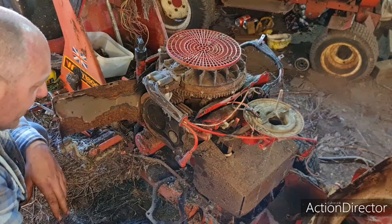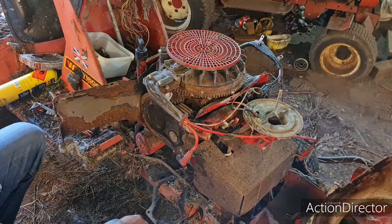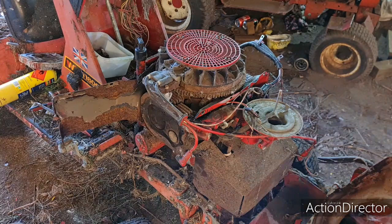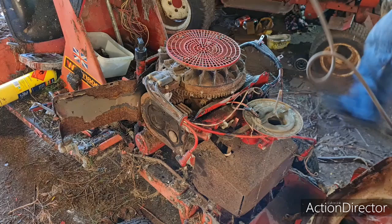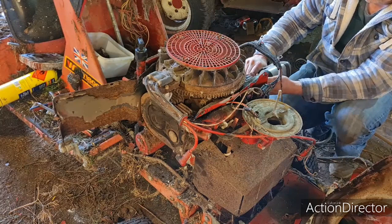So I think, and valves are actually, there's very little carbon in this engine. So I guess this is an old machine. Ah, our head gasket, which actually looks good. I mean, I will replace it if I'm going to use this engine, but when you work it out, this machine's been off the road since 98, so if this machine is say 92, it's actually only done 6 years work. That's what you've got to look at. Yes, it's old, but it's done nothing for over 20 years.